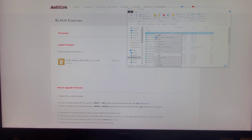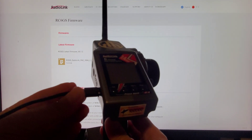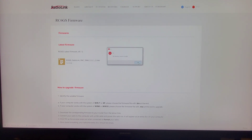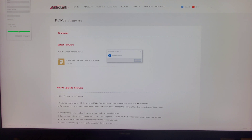Right-click and select Copy. Now what you want to do is have your remote plugged in to the USB port on the side and also into the computer. Go ahead and turn it on. You'll get a format prompt — that's normal. Don't freak out, it's not going to hurt anything. Click 'Format Disk,' you'll get a box pop up, click Start and click OK. Formatting is done — select OK.